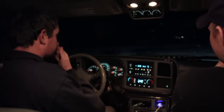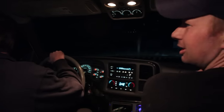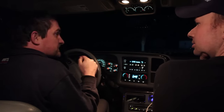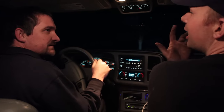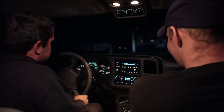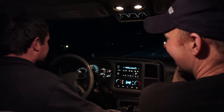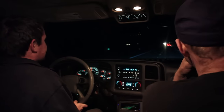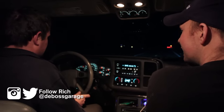After I put my computer back in my Tahoe, I never relearned it to the Tahoe — I have to do the key on and off for 10 minutes. I'll clear the codes and drive it for a bit. But if I bring the EFI Live, I can force that learn — you don't have to do the key thing. You just click it and it's done in seconds instead of half an hour. Right now I don't even know what tune I'm on, whatever I was playing with last. No pyrometer or boost gauge or anything — everything's pretty much factory with a little tune work.